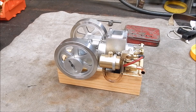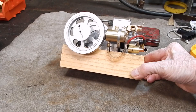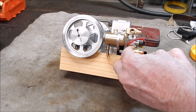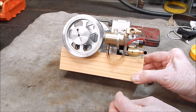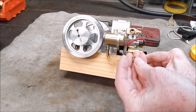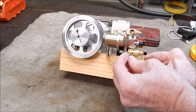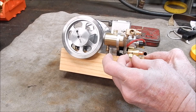The muffler has a problem. It blew the end off of it — this little plug sealed this end of the tube, it's open on that end. They soldered it, but I think the heat from the exhaust was too much for the solder. It must have melted it and it came out.